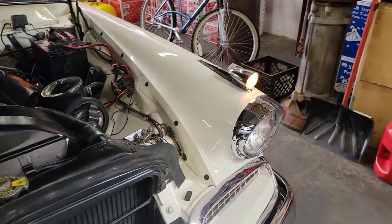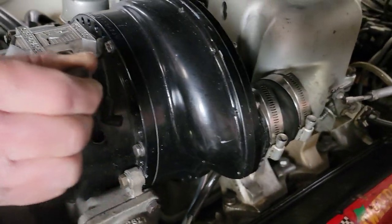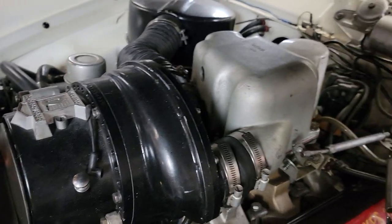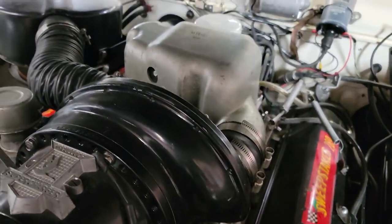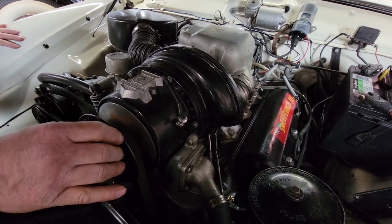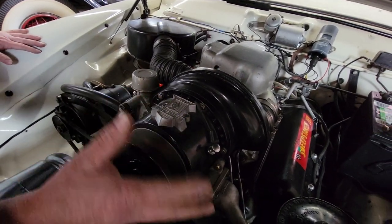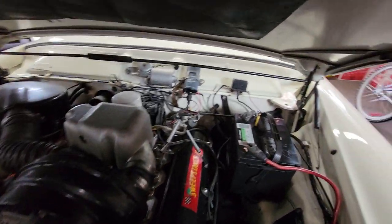Super solid, nice car. You got your McCulloch supercharger. It actually has its own oil, its own crankcase with engine oil and a dipstick, so you want to check that periodically. Right now you're in full boost. It's adjustable — these pulleys slide in and out. It's centrifugal — it actually changes the boost by changing the pulley diameter. So the faster it goes, the more boost. The higher the speed, the more this will close up. The belt will creep up the pulley and it'll slow the supercharger down so you don't have too much boost. That's freaking genius. Yeah, it's awesome. You got a belt tensioner and all kinds of other things — a big A-belt.